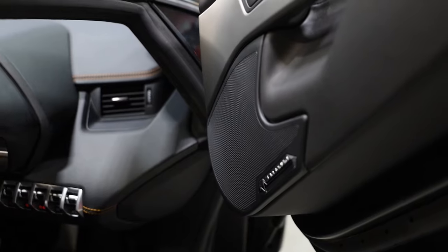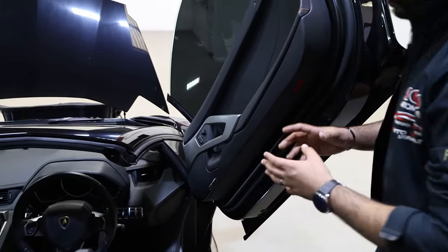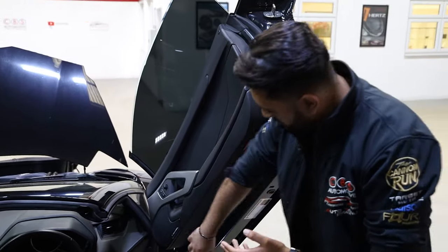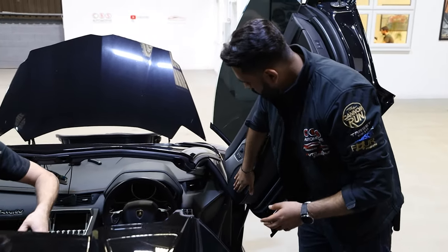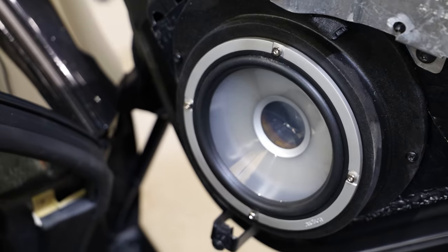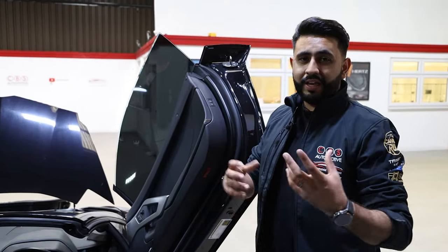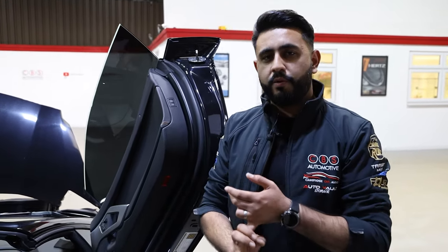The grille here is actually quite small, so the six-and-a-half-inch driver actually forms up beyond it. The reason we've put that speaker on-axis is basically to get as much surface area and excursion from that cone through the grille. It sounds really nice and solid, and that's down to the soundproofing, how we've built the speaker ring, and also the Audison Thesis six-and-a-half-inch driver in this door.